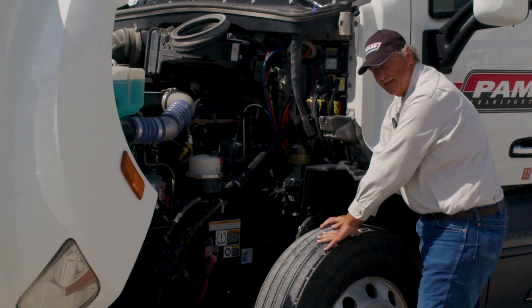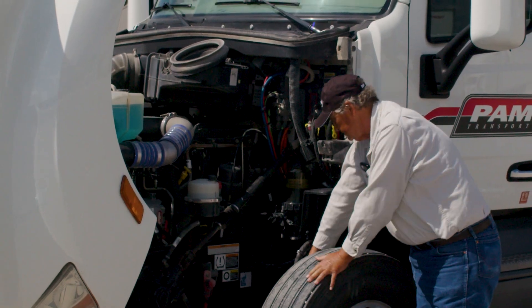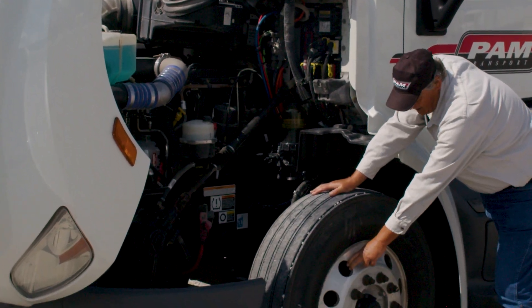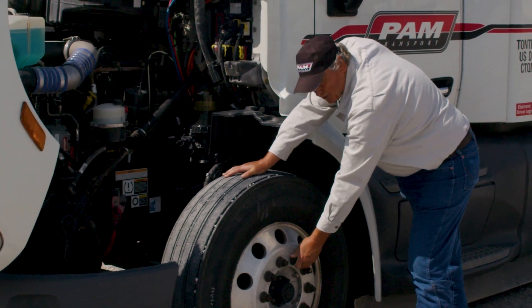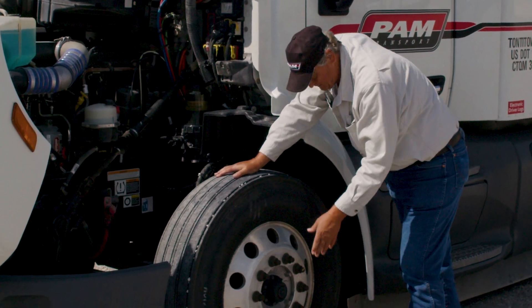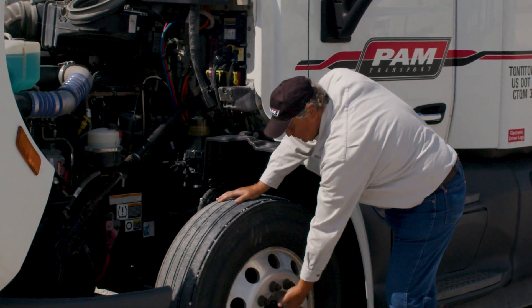Check this tire the same as you would the other side — it's got to be 4/32nds of an inch, no less. No abrasions, no cuts on the three sides. Your brake chamber is properly secured. There's no leaking, no oil, no debris inside the drum. The rim shows no signs of cracks or welds. The lug nuts are on securely — no sign of any loose lug nuts like rust streaks or shiny threads. Again, the hub oiler — make sure it's properly filled and secured with the plug.